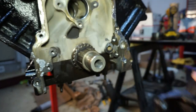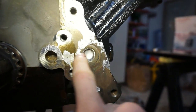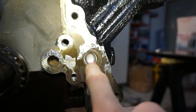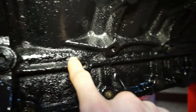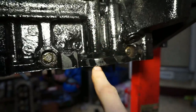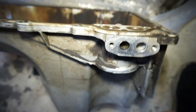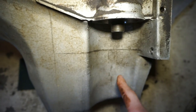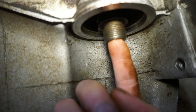Removing the oil pump — oil gets pumped in through this hole and over through this oil galley here, and down through the block. This is the driver's side of the block. You can see this little raised section here actually travels through the block over to these ports. This one goes down. The oil then comes down through here into the outside of the oil filter, through the filter screen, up towards the center, and up through the center hole right here.